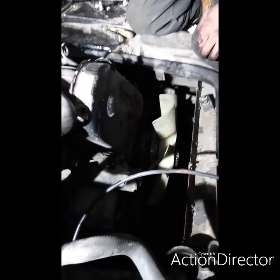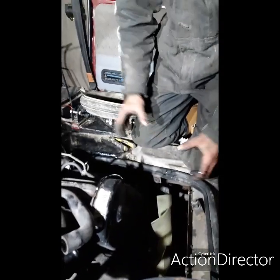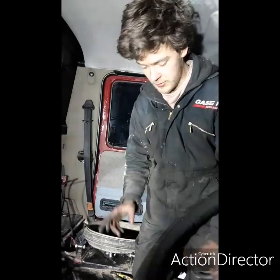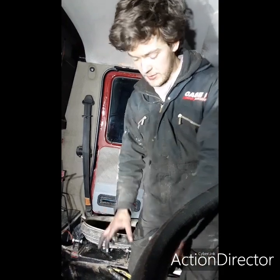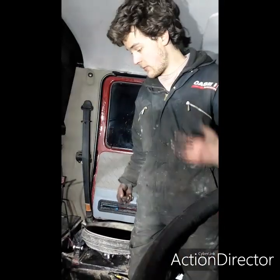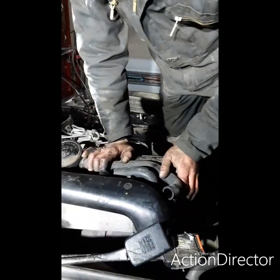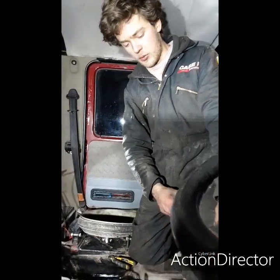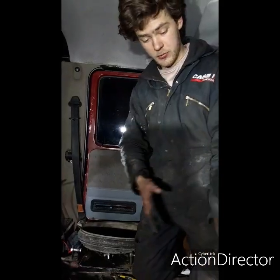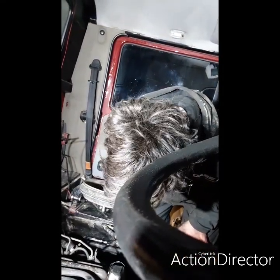So the shroud is off. I've dropped the cone section down. Next I've got to take the power steering pump off because rather than unpiping it and emptying the reservoir - I did actually just reflush the fluid not so long ago - I'm basically just going to pull it off and put it to the side and hopefully lift the engine out without it being too much in the way. The alternator and everything I think can stay on. Radiator out next - it just unbolts the bottom support and slides straight down and drops out.